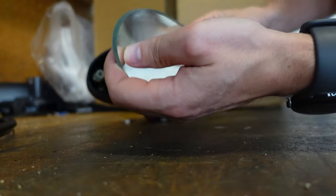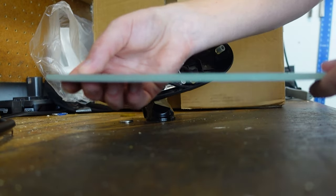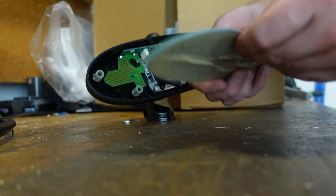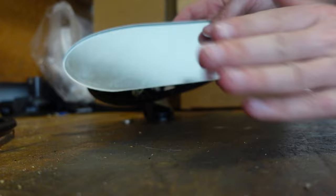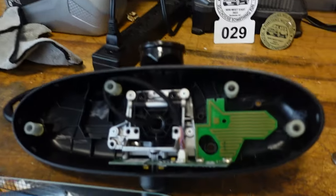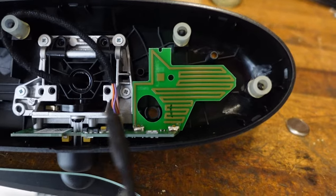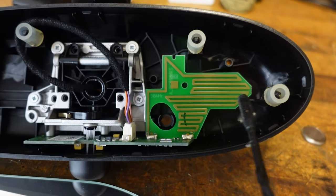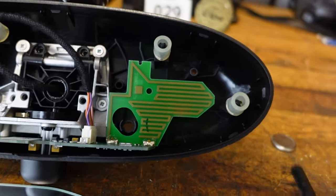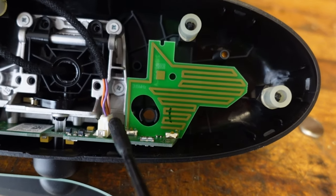Wow, the glass is really cool — it's really thin at the bottom and really thick at the top, so it's what you'd call tapered. That's probably so it's always angled down towards the driver a little bit since it sits up high. Now, here are some interesting parts of this mirror. This is a manual one so there's not much going on inside, but here is the antenna — you can see this wire, which operates at 315 megahertz according to the board it's printed on. Then we have the circuit board right below it, which is what plugs into the rest of the harness.